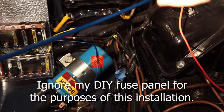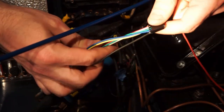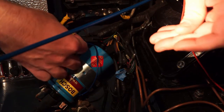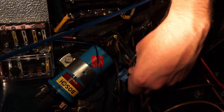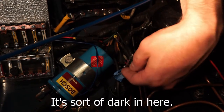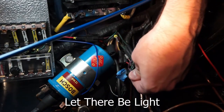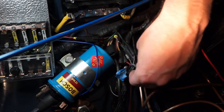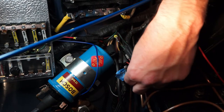All right, now we're going to make all the connections for this dome light dimmer circuitry. This yellow line that comes out needs to go out to the positive of the dome switch. So that's the purple, which is right down here. There's a purple line that's going underneath the car, and that is the one you need to connect to the yellow. The purple and white one that goes underneath the car, you just need to ground out. So I'll connect that to a vehicle ground.